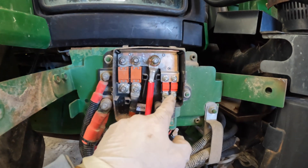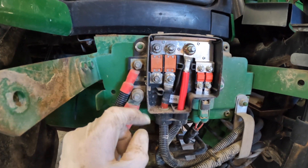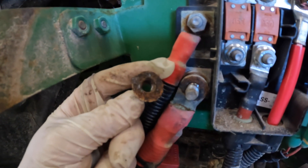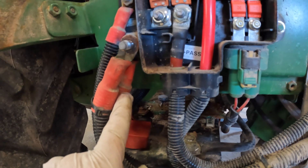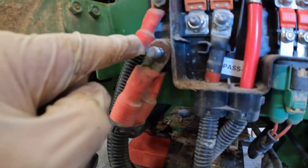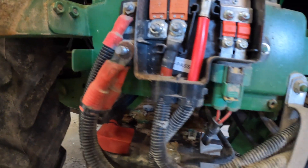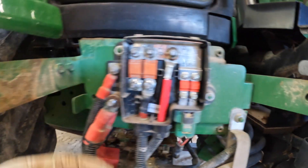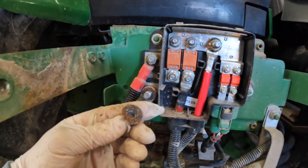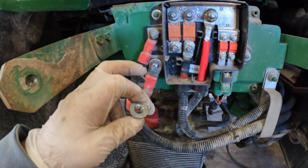Although we have some stuff in here — maybe some type of fuse or circuit breaker. Let me take this one off and clean it up and see what happens. Okay, this could be part of the issue right here — you see all that rust on the nut. If I'm correct, this battery cable behind here is coming directly from the battery, and this sits on top of that cable, and I believe this one goes all the way over to the starter. That would explain why I'm not getting full juice over there.